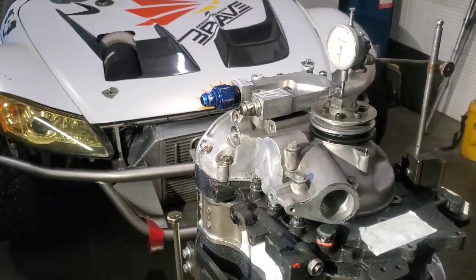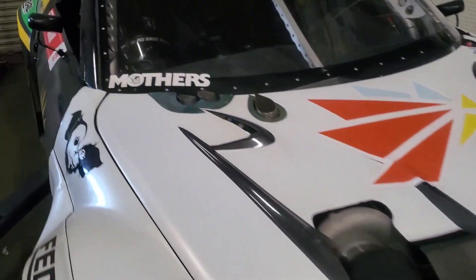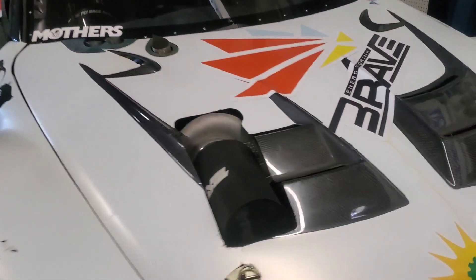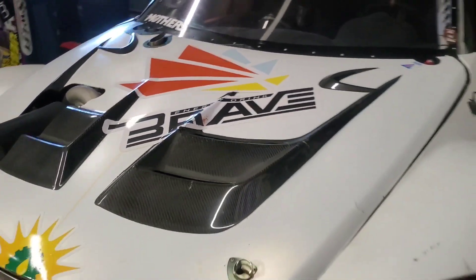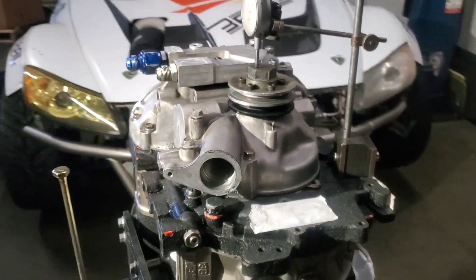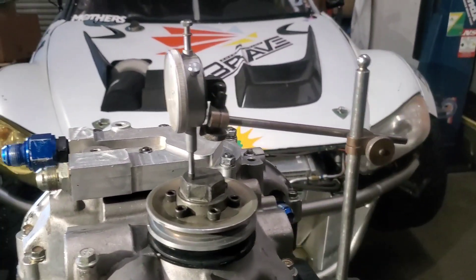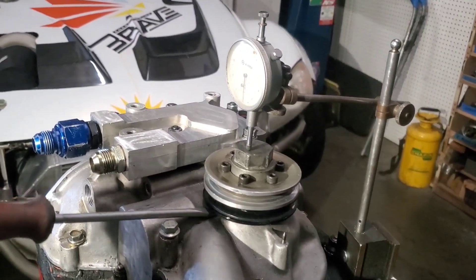I'm pretty critical, whether it be 20B, four rotor, or 13B — you don't want too much and you don't want too little. Too little, as things heat up and expand when you're making horsepower, can run into some interferences. You don't want things too tight; things need to be able to expand and contract. And vice versa, too much end float can actually lead to increased and premature wear.